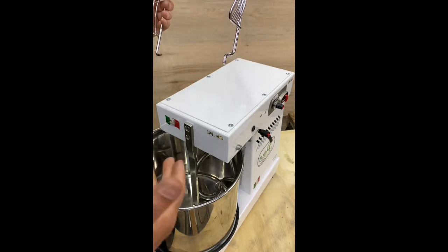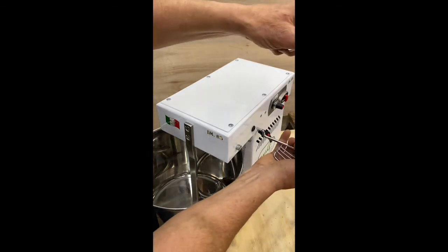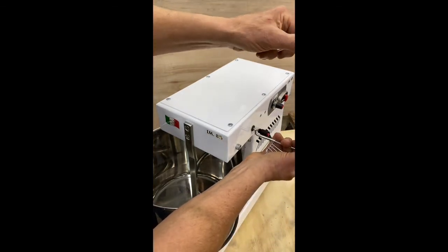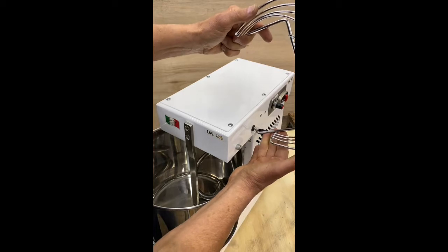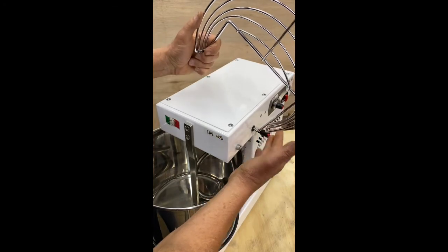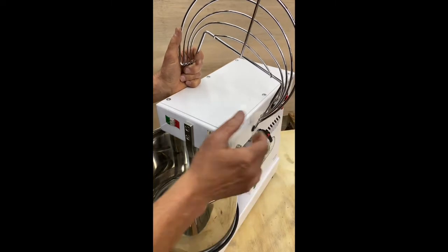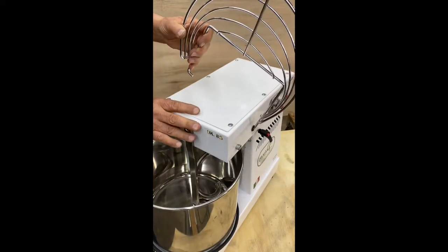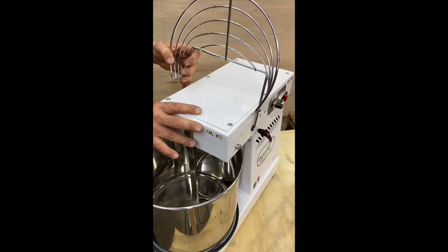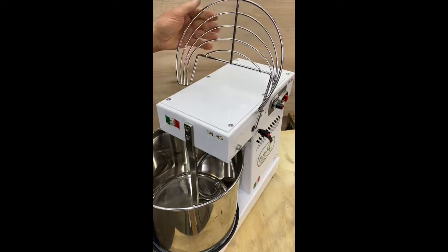To replace this guard or put a new one in, you just reverse the process with a straight insertion first, turn it a little bit, help it wiggle in there, then a 90 degree rotation, watching out for scratching on our other end, rotate it up and slide it in that last bit, pull away over here, gently, put that into the grommet on this side, and that's it.